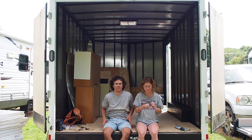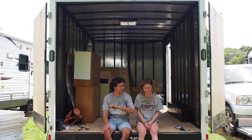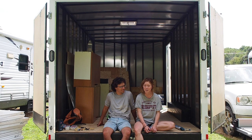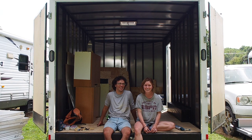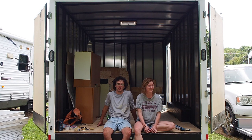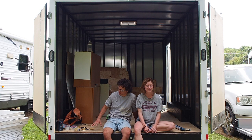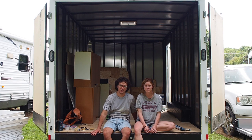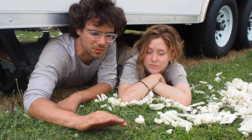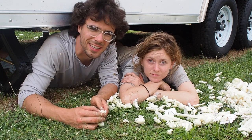So we have completed insulating the undercarriage but we definitely learned some valuable lessons. We learned that we have to cut everything as close to size as possible, otherwise we're going to use 10 extra tubes of caulk and some Gorilla tape for some really bad cut jobs. A lot of the metal work that the trailer is built on is not square, and all the tools I purchased I didn't take the time to square up yet either, so that caused a lot of hassle and headaches. We've been here for about 10 hours today — can't leave our worksite dirty. See you next time.